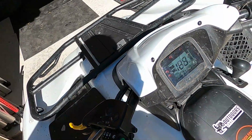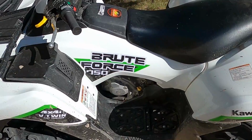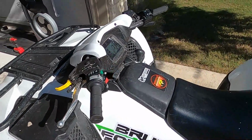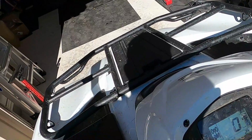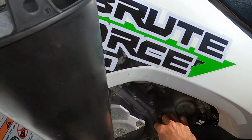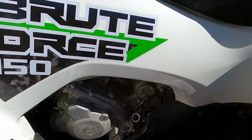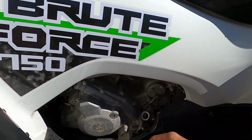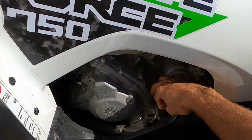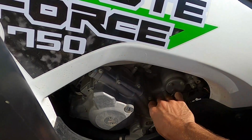Let's see what it sounds like. Okay, that's been about a minute and a half. So I'm gonna turn it off. We're gonna unscrew this. You gotta wipe off the excess oil, because the oil will rise while it's running and give you a misreading. So we're gonna go back into here, screw it all the way in, and then screw it all the way back out and check.